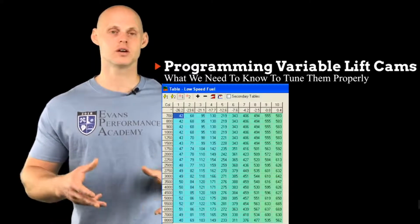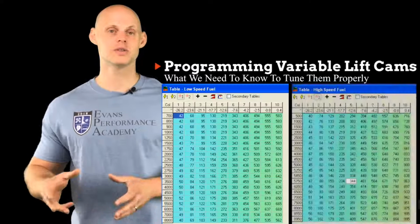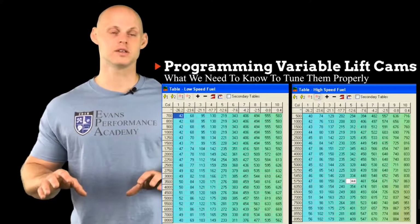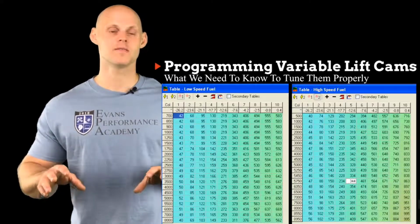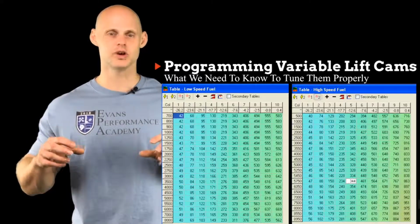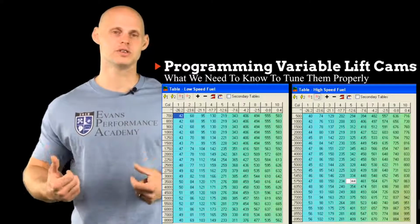So if we look here, we can see that we have our low cam fuel map, and then we can see here that we have our high cam fuel map. Now we can just look at the values in the table, and this is going to be a time-based model, so it's not going to be volumetric efficiency based. The values in the table are relatively arbitrary. We just need to know that if we move them up, that increases injector pulse width. If we move them down, that decreases the injector pulse width.